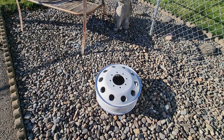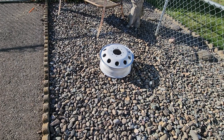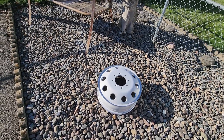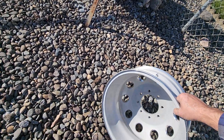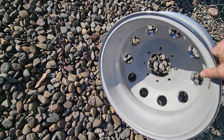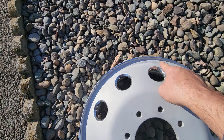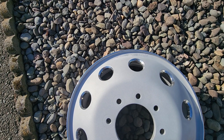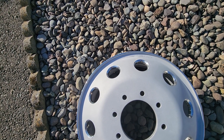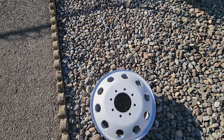I think these are the wheels I'm going to go with. These are 17-inch diameter dually wheels — they might be 6 inches wide. The flip side is that one side is going to have to be done the same way, and I had to do the same thing on the inside. This wheel I'm thinking is going to be my outer wheel on the front, so you're always going to see this side. I want to monitor that little crack there. At that distance it shows up, but with it being bead blasted I think it's going to hide it better. That's another reason I kept it like that — I didn't want to remove all the weld because then I'm taking away the strength of the weld. So that's going to have to be good enough.